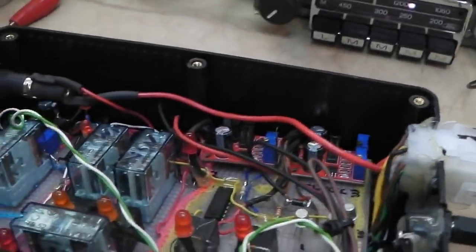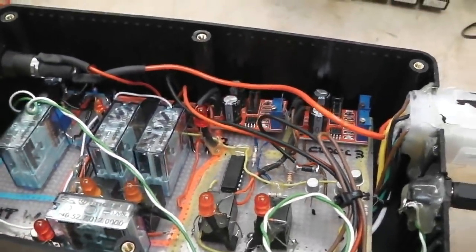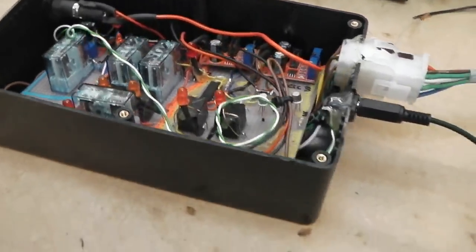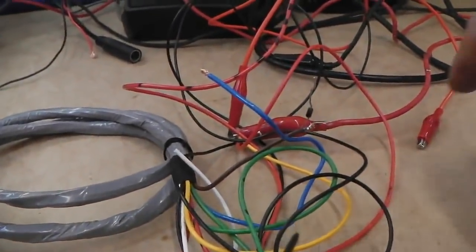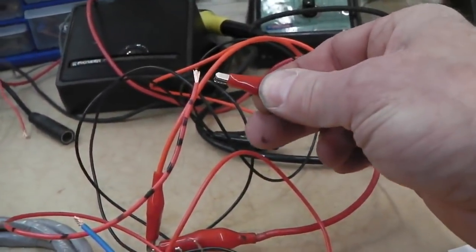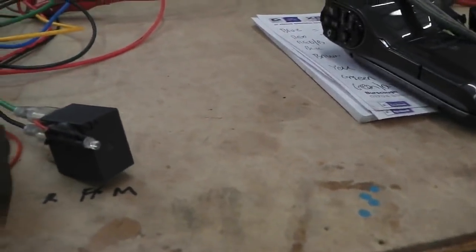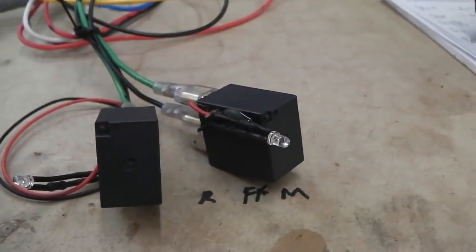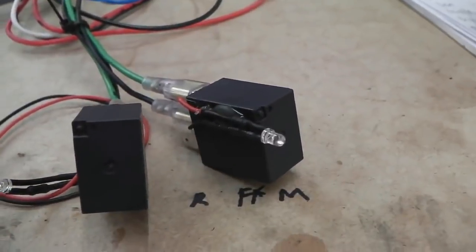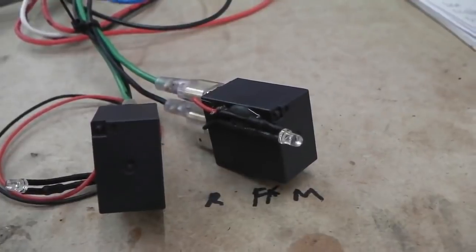So at the moment everything's idle. There's power to the unit, just standby power. You can see the clock ticking there, the red light. So we're ready now to do our first switch, which would be up on the stalk, would give 12 volts to this cable, which is intermittent. So on we go. And now, indeed, the wiper motor slave relay goes, and that would trigger the contacts of the motor, override the park switch of the motor, set it in motion for one cycle.